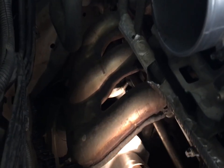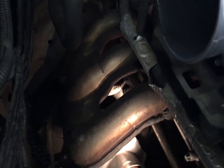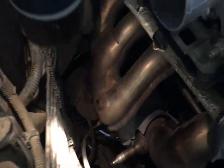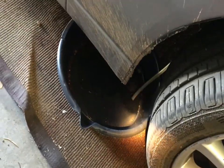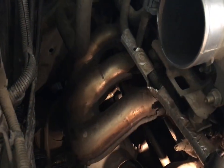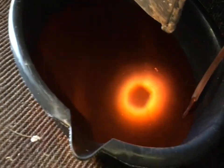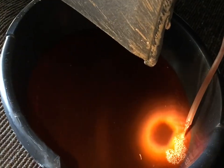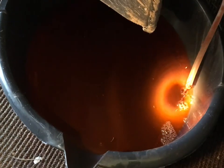I've placed my vinyl tubing on the drain plug from the heater core — you can see it back there where the light is shining. That tube just descends down onto the car and I've got a drain pan right here ready for that fluid. So now what we do is take an extender back here and loosen this up to let that fluid go. After loosening that bolt we've now got a nice flow from our heater core into our pan. And this is not a small amount of fluid — this is all stuff that would have been stuck in the engine if we hadn't gone through this extra step.